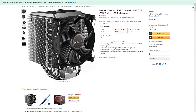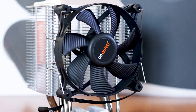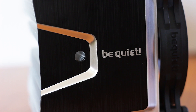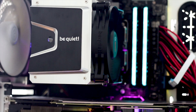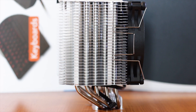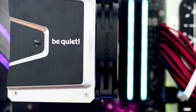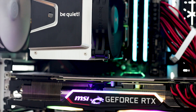The Be Quiet Shadow Rock 3 is available for around 50 US dollars or Euros, and truthfully it is a rather good mid-range CPU cooler. It has a good balance between performance and low noise operation while being reasonably priced. The build quality is great and so is the design, which may not be for everyone but is certainly on the unique side of the spectrum. The cooling performance is also good, placing the Shadow Rock 3 right next to other coolers in its price range such as the Noctua NH-U12S or the Be Quiet Pure Rock 2. One of the main advantages is its clearance — thanks to the offset heatsink and heatpipes, clearance for both the RAM and graphics card is very good. However, the trade-off is average space at the back of the cooler, making the installation of a second fan for a push-pull configuration rather tricky.